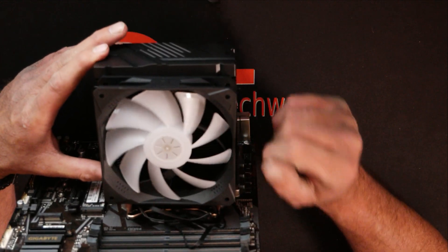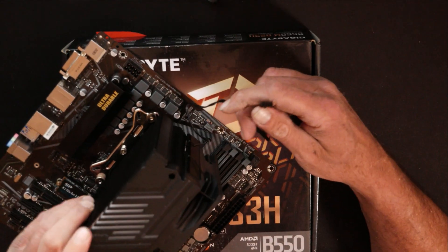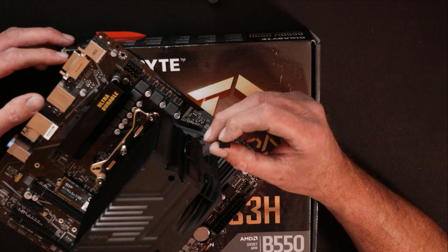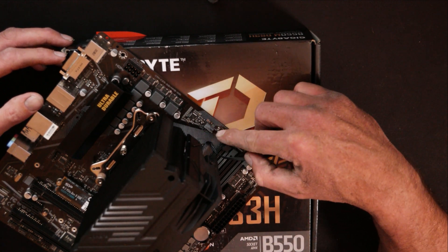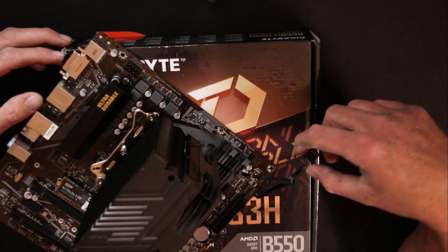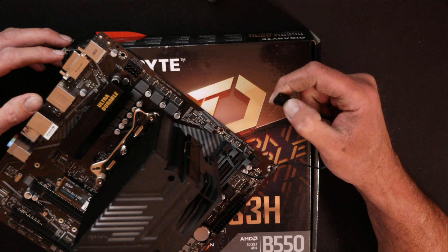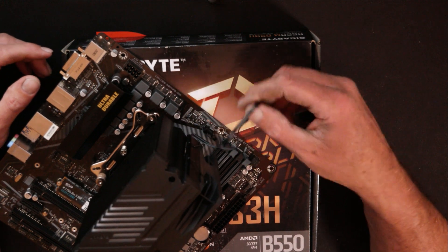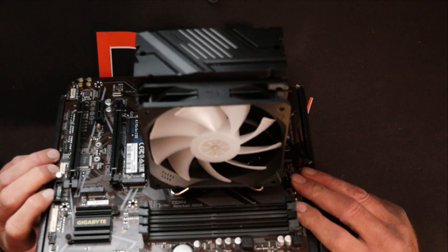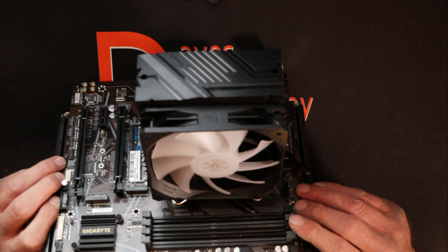Got the fan adjusted about right — looks pretty level across the top. One nice thing about this cooler is you only have one cable to deal with — you don't have ARGB or RGB to deal with, just the four-pin PWM fan header. On my motherboard I've got a little gray four-pin PWM fan header that says 'CPU fan.' You got a little notch on the connector and a notch inside the housing of the wire — just line them up and slide them down over. I'll take a zip tie and tie these wires back once it gets in the case. There's the finished product. I'm going to get some RAM put in this motherboard and get it in the case, and get some glamour shots of what this thing looks like when it's installed and lit up.